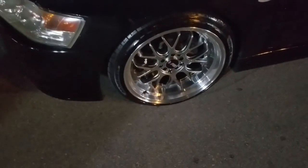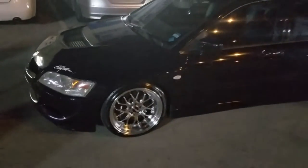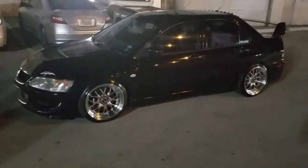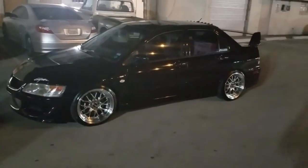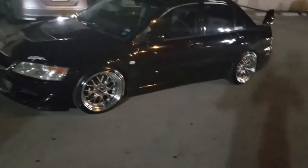This is the Hyper Dark finish. It cleared the Brembo brakes with a 3mm spacer, so you will have to use a 3mm spacer. Looks like it's going to touch but it won't — I promise you. It's going to be right there but it won't touch unless you've got some thick paint on your Brembo brakes.